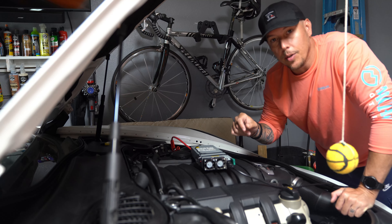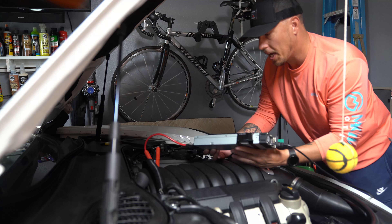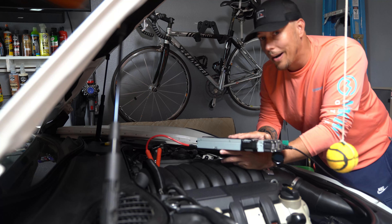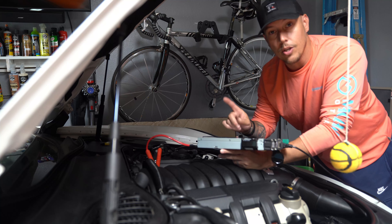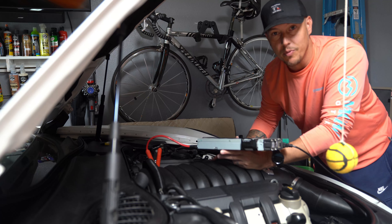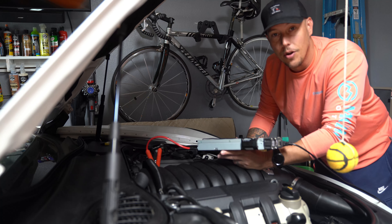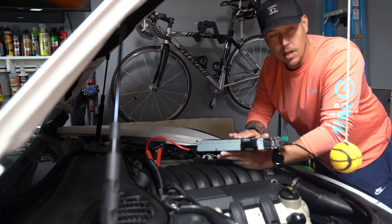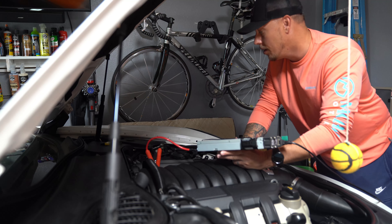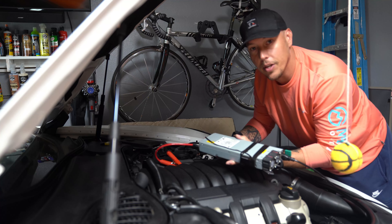Real quick before we hop in the cab and start hooking up the PIWIS 3 — this is my power supply unit that I've built. If you don't have one, make sure you get one. You can watch this video and I'll show you how I made this one for under $100. Typically the models you'll need cost $600 up to $2,000. Make sure you get at least a 60-amp unit; it needs to be adjustable — you want 13.5 to 14.5 volts. We have this one set up at about 14.1 right now.